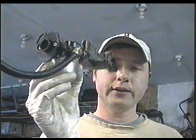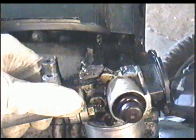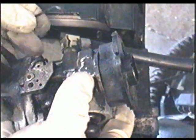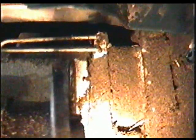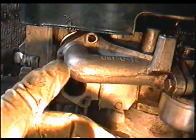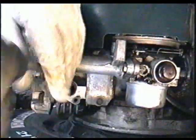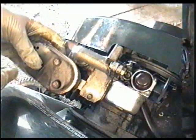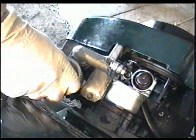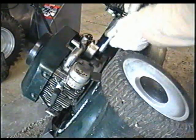So now your carburetor is fixed up and ready to be installed. First, hook up the part of the linkage in the lower hole here. So this is what it's going to look like. The linkage is in there. And it's the second hole from the front here. And now just put the two bolts on here. And now just install your muffler. And that's a 7/16.